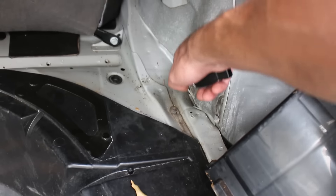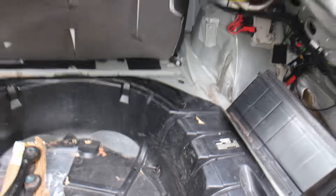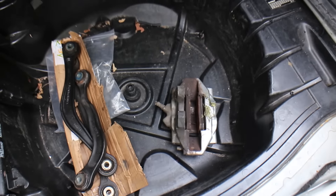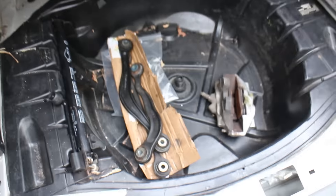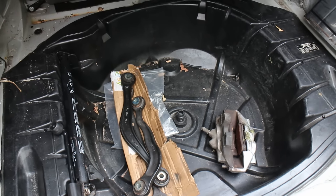My body guy is going to cut whatever he needs to cut once I have the second car. The passenger side does not have a brake caliper — I blocked off the line with a vice grip for now, as you can see right here. It basically pinches off the brake line. Brake fluid leaked out, so I had to get at least some braking on three wheels. I put fluid in and it brakes a little bit.